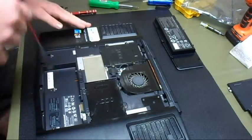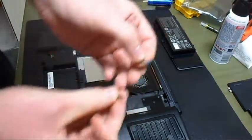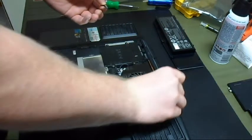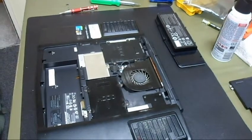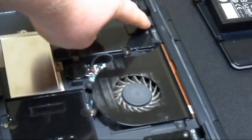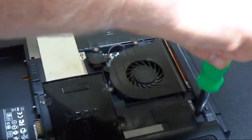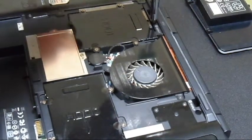Take off my fans again. We'll try to keep it clean every time I take it apart. Now then, for this, get these two pretty much about medium-sized screws, but they're the longest ones you'll have. And they go right here. Right there. One here, one there. Now, gonna zoom in just to show you. Right here, that's where one went. Then up by the second hard drive bay, there's one right there. Now, what we're gonna do, tighten those two in. There we go.